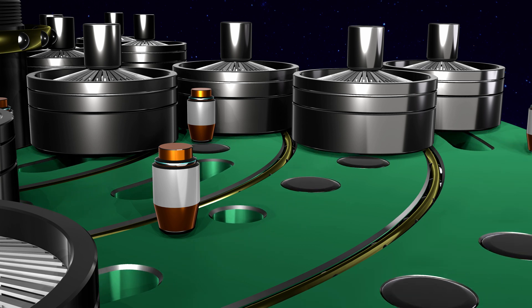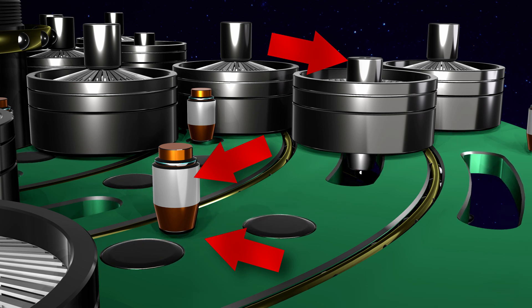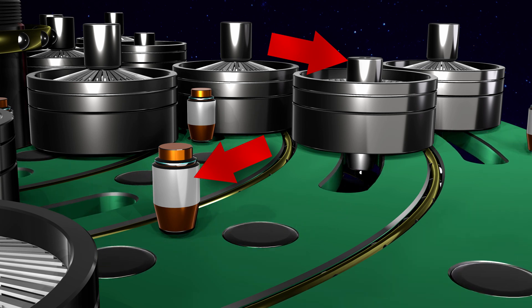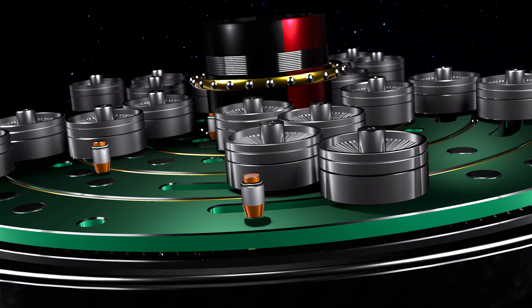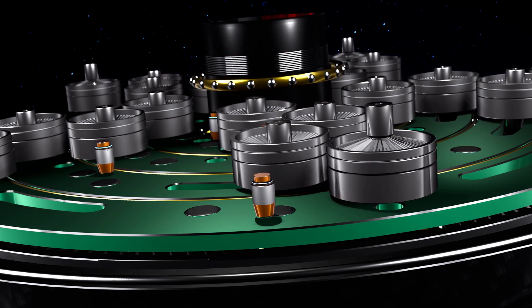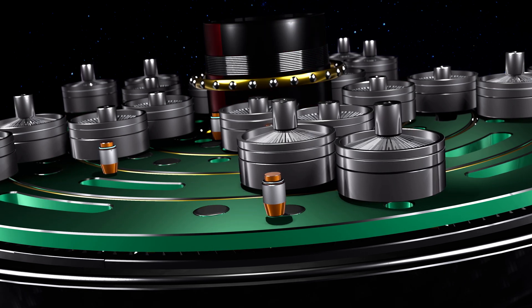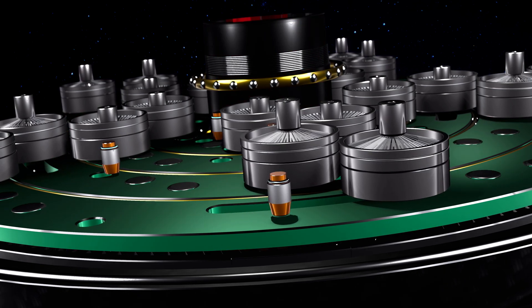When the cyclist shifts, an order is sent to the system, which then only waits for the sensor's green light before the actual change takes place, only a fraction of a second later — this regardless of which gear is selected. The locking pins of the electromagnets lock or release the carriers, which, as we shall soon see, affects the gear ratio in a rather intricate way.